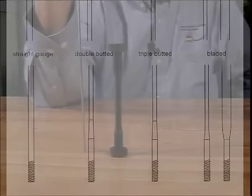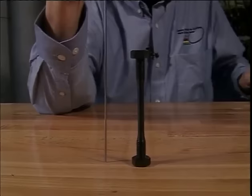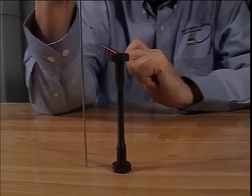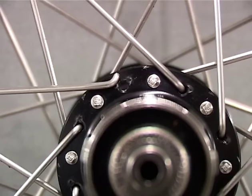The resistance to breaking of a butted spoke is very high. When under excessive load, it reacts in a similar way to the straining screw used in the machine industry. However, if the load is too high, the middle of the spoke is stretched until it breaks at this spot. Spoke failures on the spoke elbow, on the other hand, are caused by fatigue. The causes are the play between the hub flange and spoke and/or insufficient spoke tension.